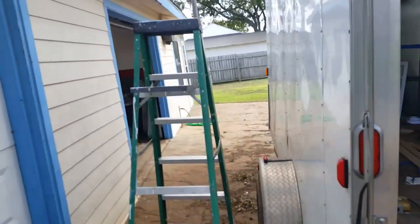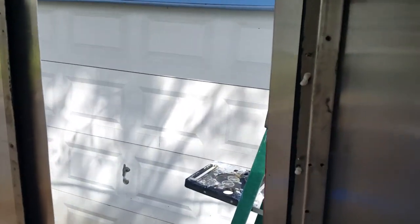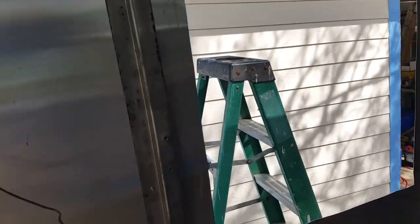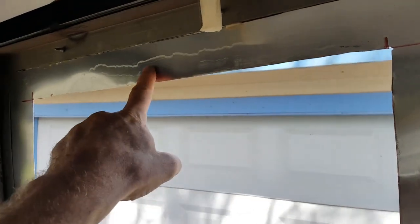Going outside to look at the layout — the four pilot holes tell me where the rectangle is going to be. You can see the holes; they're about two inches from the rain gutter, which hangs a little lower than the header inside. There's the first hole cut out. It gets very loud in here when you're cutting, so if you're noise-sensitive wear hearing protection. Because of vibration I also wear leather gloves to protect my hands and impact-resistant glasses to protect my eyesight.